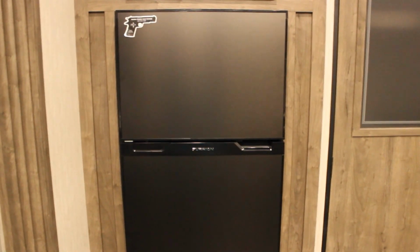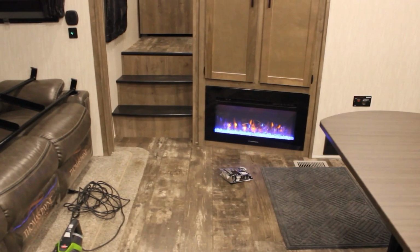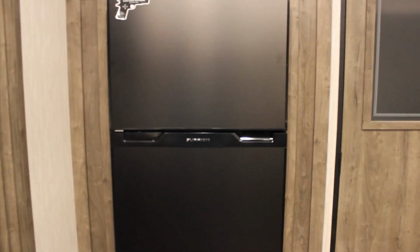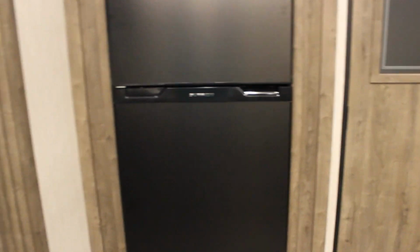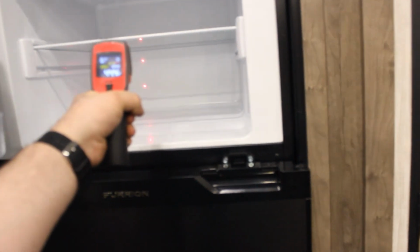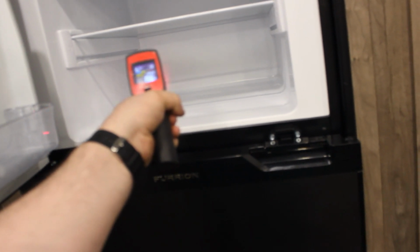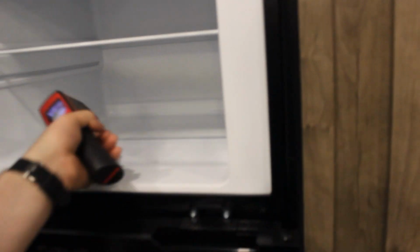And we are going to check the temperature and see if we have made any progress here. So we'll grab a thermometer. I actually got the electric heater on in here. And we are wonderful. 65.5 degrees. 67 at the ceiling. 64 at the floor. We're going to open the freezer up and take a temperature right away. And we are down to 44.4 degrees. 43 in the bottom. Oh, we're getting actually readings around 8.9 degrees down below. It must be an element. Yep. Oh yeah, it's super cold to the touch. Well, that's great. 12 degrees. So that's great. She's definitely working.